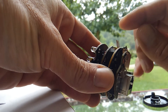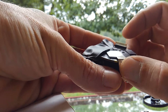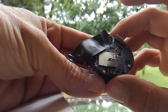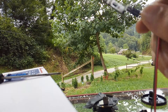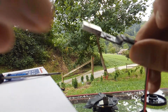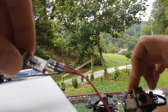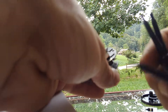Go back to your main board. On this piece of shielding where the ground strap is, lift that up — right there is your ground, receive, and transmit for your serial port. You're going to need a UART device — a USB UART — and at a minimum hook up the receive, transmit, and ground. I'm going to power it through the PoE power supply. Ground goes to ground.